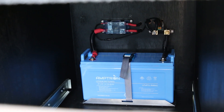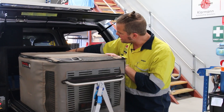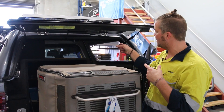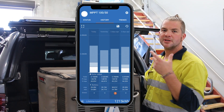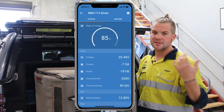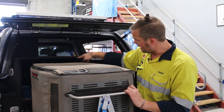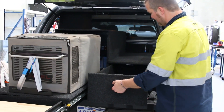That leaves us room to put the battery in there. We've got the Victron shunt from the BMV 712 Smart Monitor in there, so you've got Bluetooth connectivity as well. While you're driving you can have an app running on your phone where you can actually see the charge rate, state of charge, voltages, time to go — all the battery information. The main fuses, a twin ANL fuse holder, are right in there as well. So obviously you get another drawer here too.